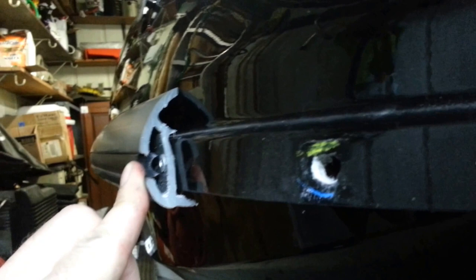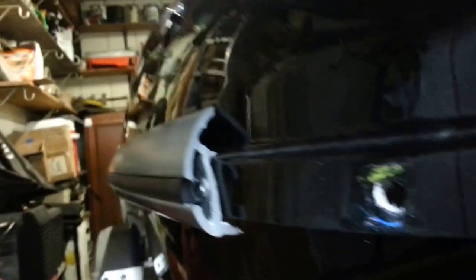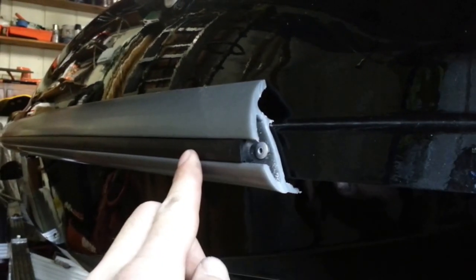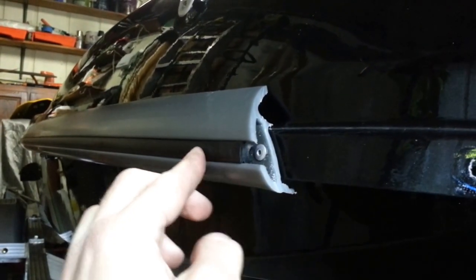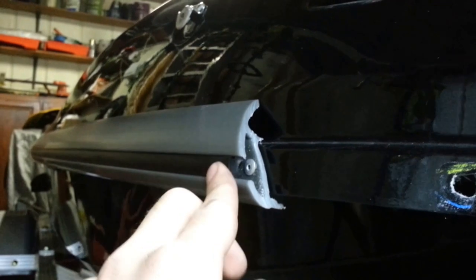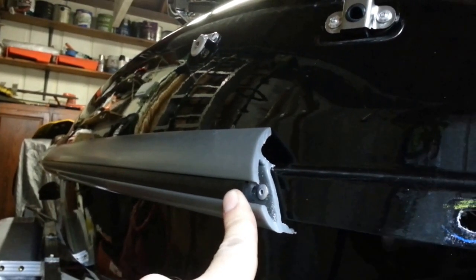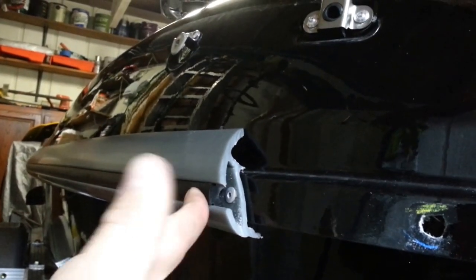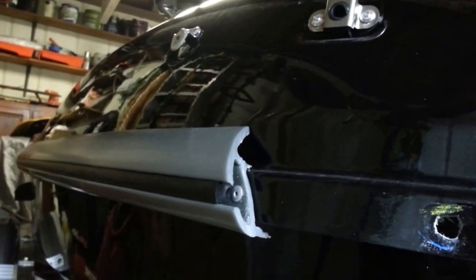So this is what it looks like — it's just resting in the channel, already pre-molded, and we can just slide this out. It's not easy to do, so be very careful when you get started. The plastic piece I removed earlier actually overlaps this by a certain point, so what I would do is hold that plastic piece back up so you know how much overlap you've got. That way you can use the needle-nose pliers without going past that overlap, so if you start marking this up and decide you don't want to continue, you won't have ruined the entire strip — only the very end, which will be covered by that plastic piece.